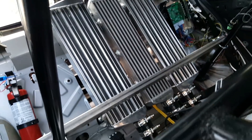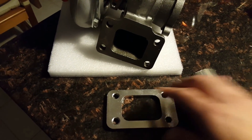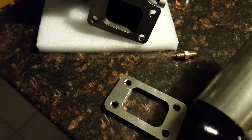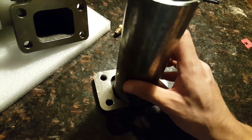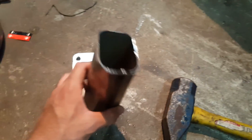Getting to the exhaust side, I had to link the exhaust to the turbos. I hung the turbos in place using the intake pipes to get an idea of positioning, then made the exhaust pipe to link the turbos to the up pipe and down pipe. For the exhaust flanges, I got pre-made flanges, hammered the end of the tube square, and fitted it onto the flange. After quite a bit of hammering the end was perfectly square and fit the flange well, with any remaining gaps to be filled by welding.